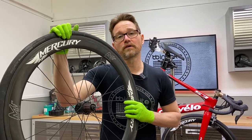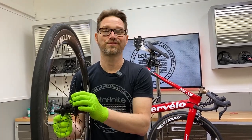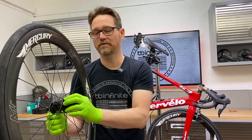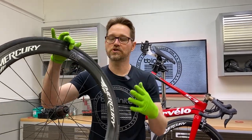So what do you look for when you're looking at a pair of wheels to buy? Make sure none of the spokes are touching each other unless they're round. Because the round ones, when they do that cross like that — three cross, whatever it is — they don't have this problem. It's only the bladed spokes because of the surface area contact. It's the nature of the beast.